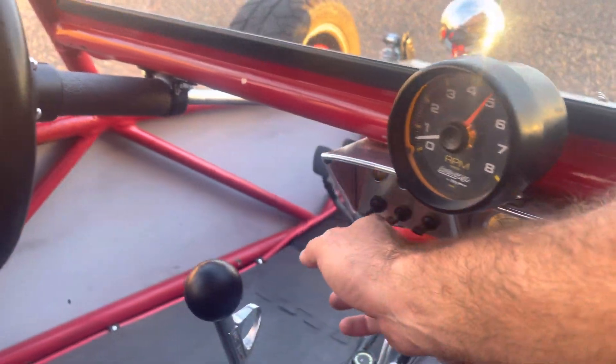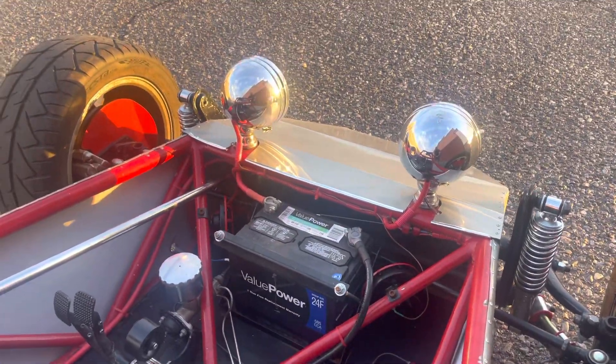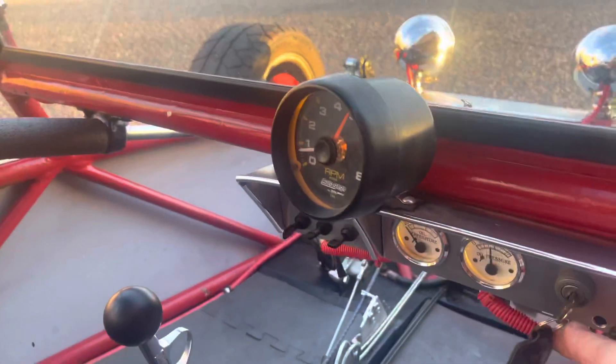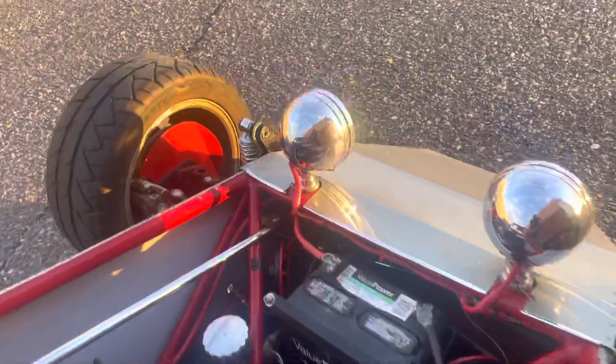Give a little more gas here. You have twin Hella rally-style air horns — they're super loud. Here is your horn button; you can hear those bad boys. It's super, super loud. It'll piss off the car in front of you if they don't go. You can actually disconnect one of the negative wires on either horn so you only have one, but I like both of them.